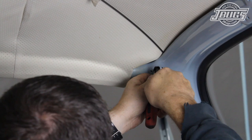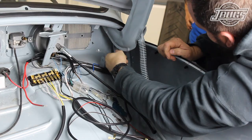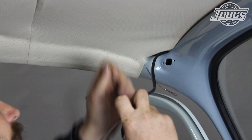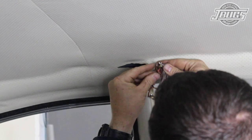If you're lucky, the wire may be able to find its way all the way down and into the trunk. We weren't, but fortunately the headliner at this area is slightly loose so we were able to grab the feed wire here. In the trunk, we attach the dome light harness to a headliner bow and feed the harness up the A pillar to the loose portion corner of the headliner. The headliner bow is pulled from the harness and the harness is attached to the stiff wire coming from the dome light hole, then pulled through to the opening. The stiff wire is removed and a new dome light assembly is hooked up.